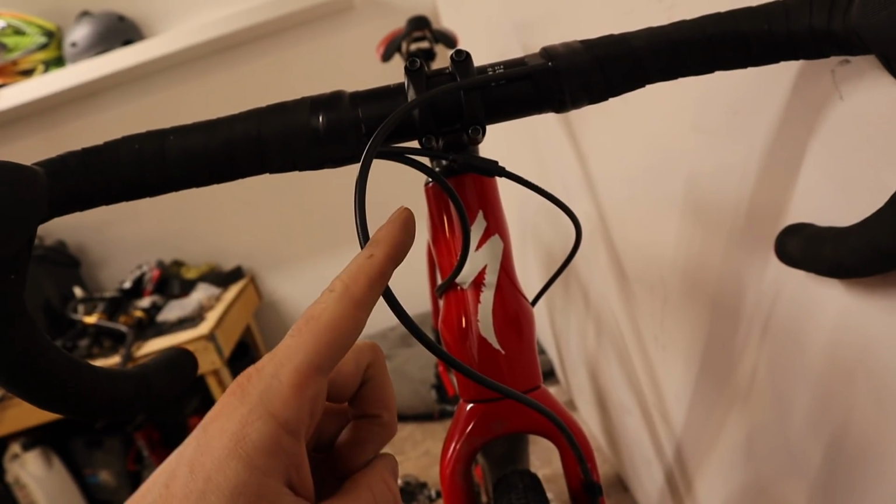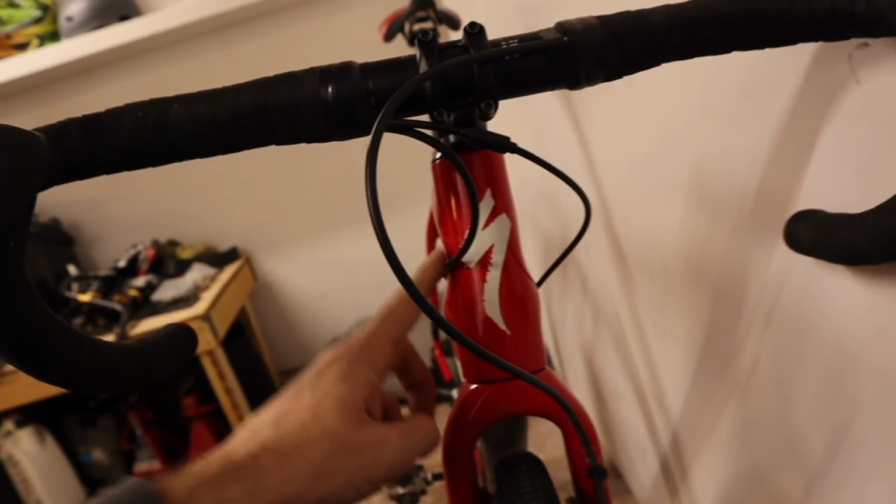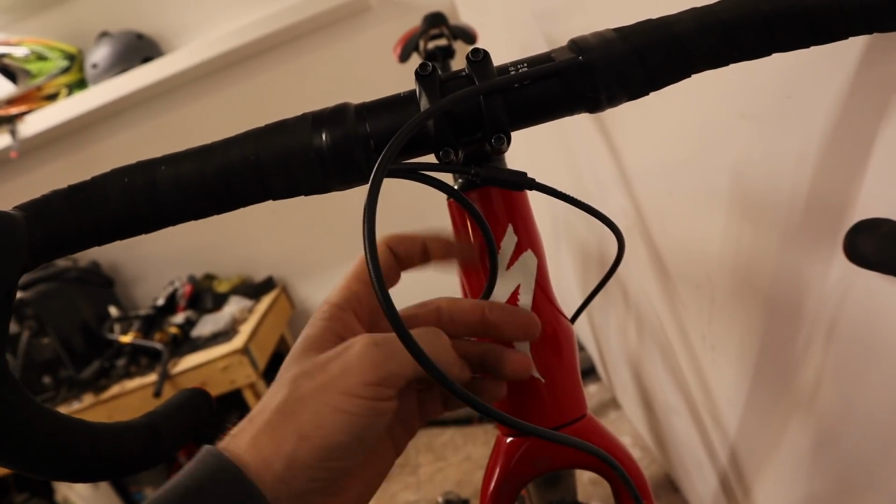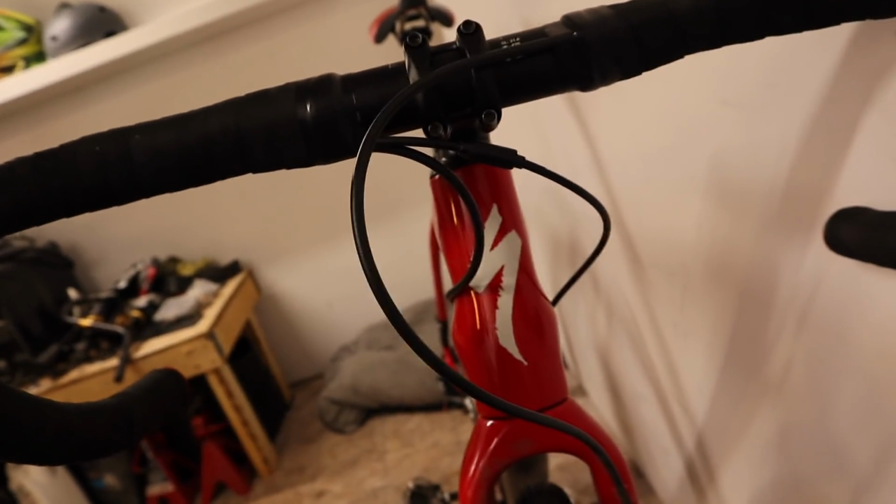The solution was fairly simple, just swap where the brake line is going in with where the shift cable was going in. And while this is still fairly short, it does allow enough slack and movement without really impeding performance to move the handlebar to a reasonable degree. Thankfully, in my infinite tinkering wisdom, I didn't tighten down the nut onto the olive so hard that I couldn't reuse it, which allowed me to retry this setup.